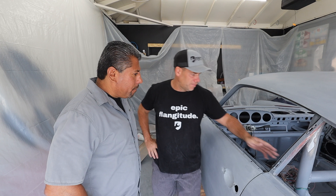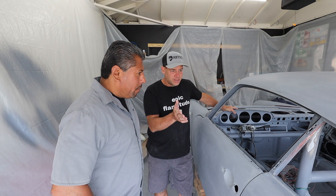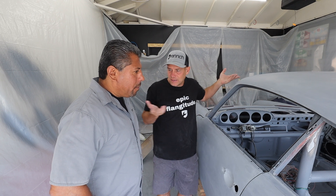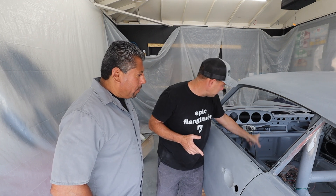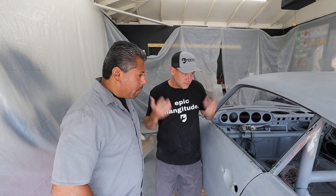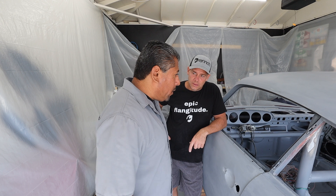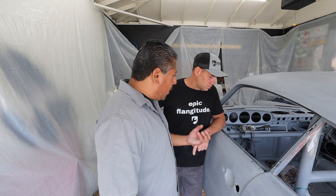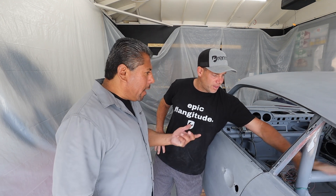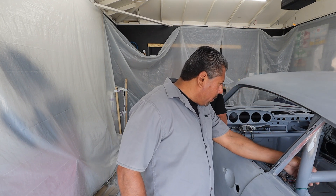What about the interior? I'm going to hit it with body color, but most of it is going to get Dynamat and carpet — it's not going to be very visible. There are only a couple spots that'll be visible. Just address the areas that are going to be seen and make those real nice. Hit it with a Scotch-Brite pad — unless it's really gritty, in which case hit it with some sandpaper, then a 400-grit, then the red Scotch-Brite.